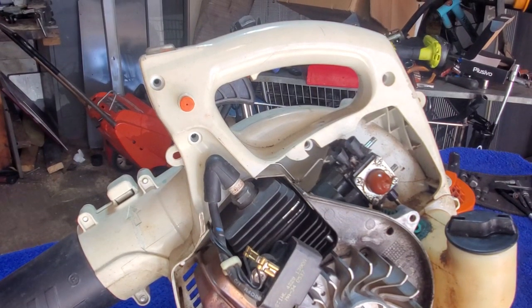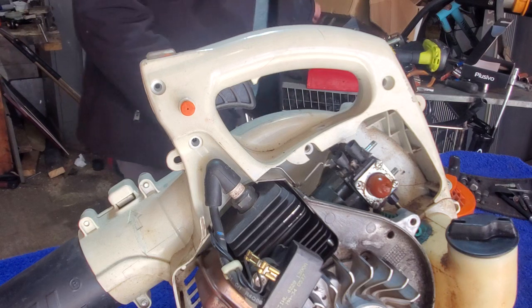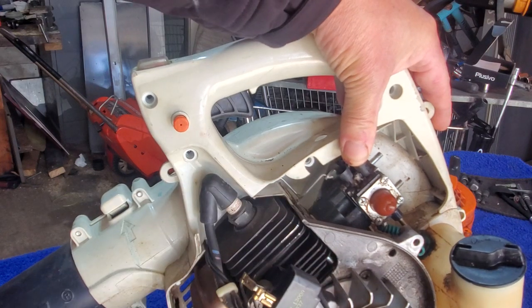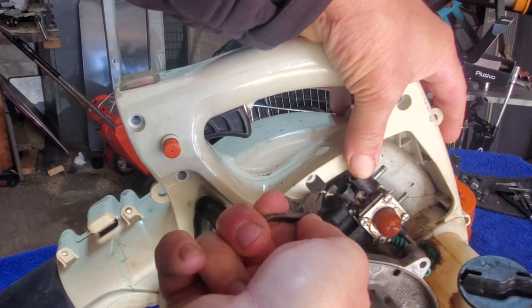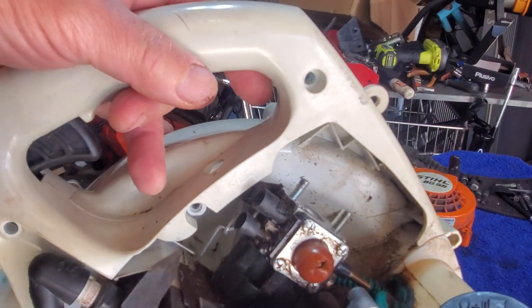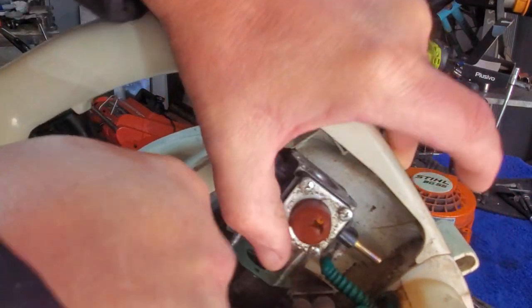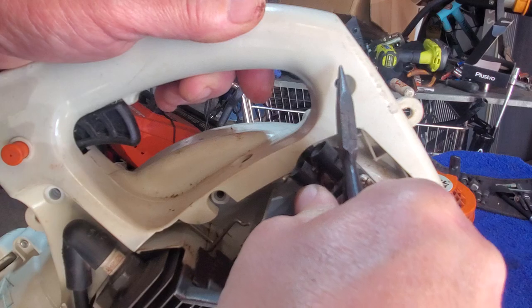Okay, so I decided to stop being a wuss about it. I'm just gonna take my really small needle nose pliers and yank that linkage off. I'm just really not into tweaking linkages too much, but right here where that throttle linkage is — I'm getting up underneath here with small needle nose pliers, getting it up as close to the elbow as I can, and just twisting this thing out while pulling out on the carburetor a little bit. Okay, so I just popped it off there. No big deal, didn't bend it.